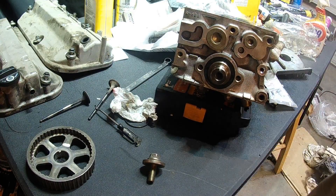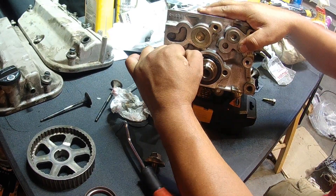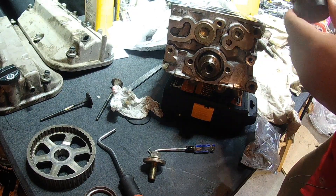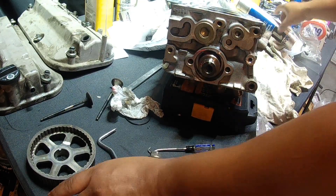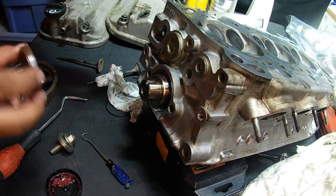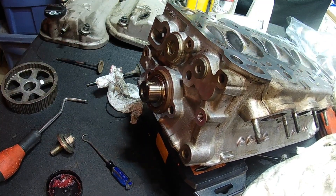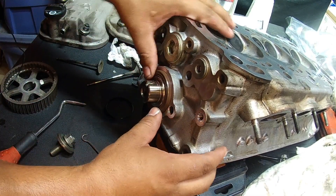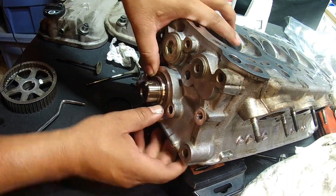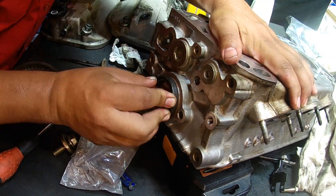Be very careful when you're handling the cylinder head — it's very sharp and can cut you. The goal here is just to fish this old seal out. Again, try not to mar the surface. Go ahead and bring in some grease. I'm going to put it on the inner part of the camshaft itself. Bring the seal in and get some grease on the inner seal. Try to get this started as flat and level as possible. If the old seal isn't damaged too much you can actually use it to help guide the new one in, or a big socket. I'm just pushing with my hands here, trying to do it all evenly at once.